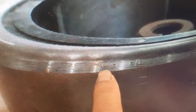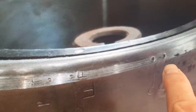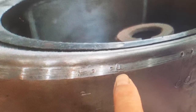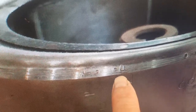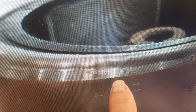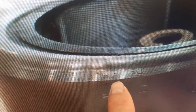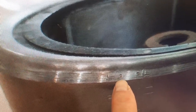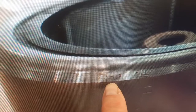That says F and that says T. So if you go to the two marks, then you keep rotating it counterclockwise. The first mark is the firing mark — that's not the mark you want for timing the chain. When you're installing the cam sprocket and the chain, you want to line up to this little dot here that's next to this.